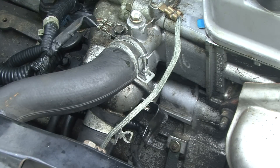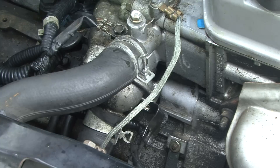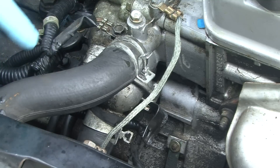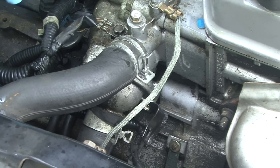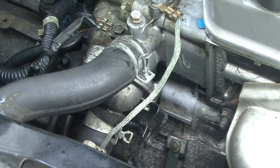The thermostat is down here and it lets the hot liquid up top flow through the radiator and come back. The other thing is when it was overheating, I turned the heat on in the car. On Hondas the heat flows through the head, so at a few RPMs there was enough flow through the head and into the heater — the fan blew out superheated air and the car didn't bubble over or get hot.